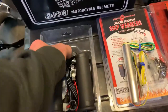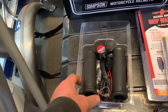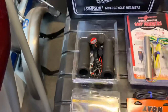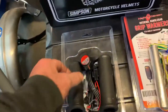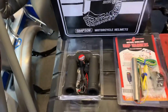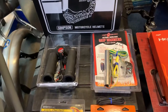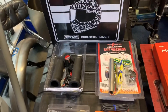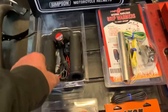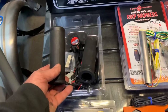Old faithful that I use on a lot of my bikes, especially the cruisers — the Taurus. You can use them on a cruiser in one inch, and then you just need a grip cover — put a nice decent leather-covered lace-up thing on it. Two heat settings. These run about 55 quid. Very good, very cheap, very easy to fit as well — no drilling. Just run the wires down the bars and leave a bit of a loop for your throttle to allow it to twizzle.